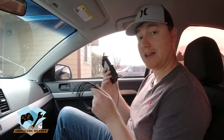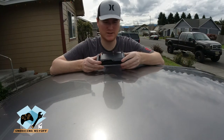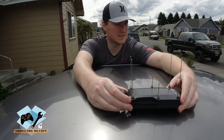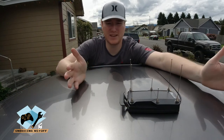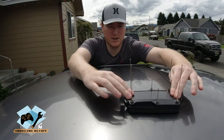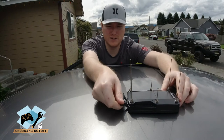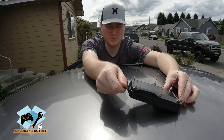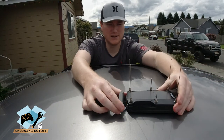I'll show you how to place this and then we'll feed this line in and go over what we do on the inside. Here's one of the easiest parts of the whole install process — we're going to take this unit and place it in approximately the center of the roof with as much spacing from front to back as possible so that nothing else will interfere with the antennas. Once you put it in place this thing is pretty sturdy and it's not going to walk around on you. If you need to move it or take it off, you just lift at the handle and it comes right off.